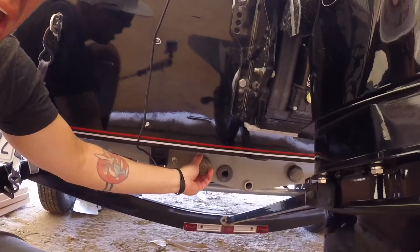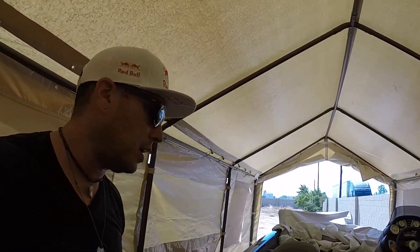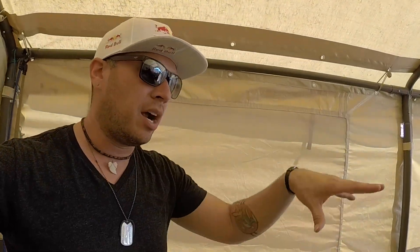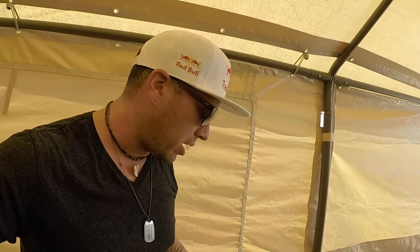Put the screen back on, turn off the pump. I went ahead and put a little bit of Dawn dish soap in there, let it run, then drained all that out. Maybe a little bit of algae or dirty water got stuck in there from last time I was at the lake and clogged it up — easy fix. So if your live well ever stops filling up with water on one of these boats, unscrew that screen, hit it with the water hose on low pressure, turn on the pump, and see if that fixes it. Easy fix.